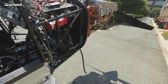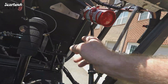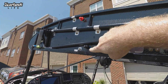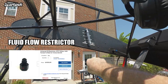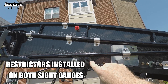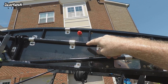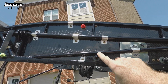Here's what the fair lead looks like in front of the rear seat. I installed the fire extinguisher, so from the inside it's just a matter of reaching up here and releasing the latch and dropping it down. Since I made the sight gauge video, I've added a restrictor at the bottom of the sight gauge. This restrictor just reduces the orifice so that there's less sloshing around. I didn't put one up at the top - I can come back and do that later. Most of the head pressure is going to be down here on the bottom anyway, so it should help prevent the ball from jumping up and down inside the sight gauge.